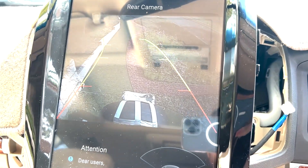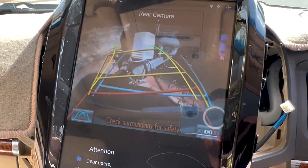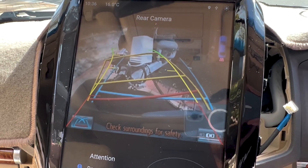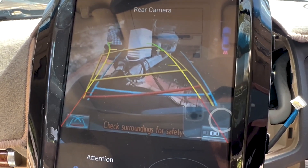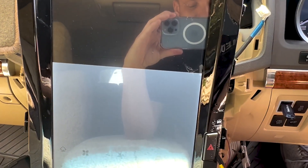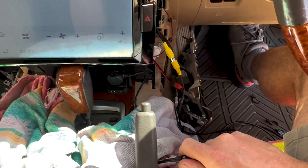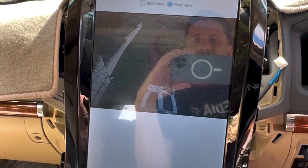You can see what will happen: you'll see the caravan camera coming up, and then I'll unplug this — once the caravan is unplugged, it goes back to the car camera. That's how it works; the caravan camera wins when it's hooked in. On the actual unit we have the CAM app here. It's blank at the moment because the caravan camera isn't plugged in. When I plug in the coil cable at the back, there's the caravan camera.